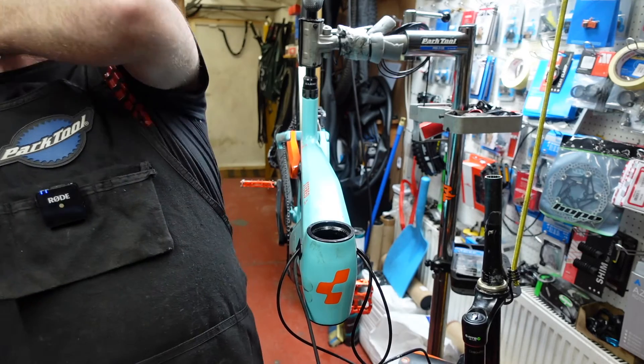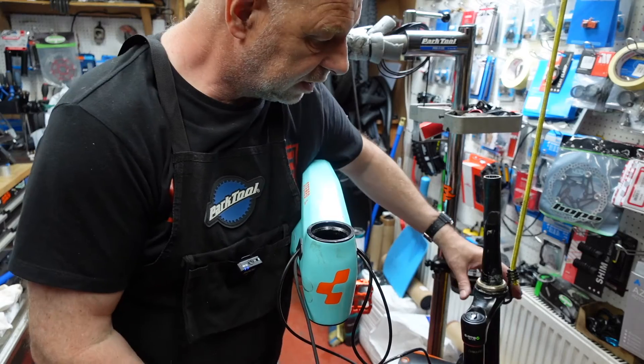I know that these particular bearings are all right, so we'll probably pop this back in. Just to recap: you'll find that most bearings for mountain bikes are the same, with the exception of probably Cannondale and maybe Canyon, who like to do things a little bit different. You'll generally find that most headsets are fairly generic across mountain bikes. You've got two main sorts for your bottom one — that's the tapered side, the bigger one: 51.8, 36/45 or 45/45.